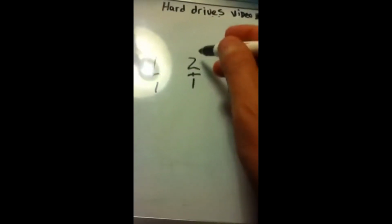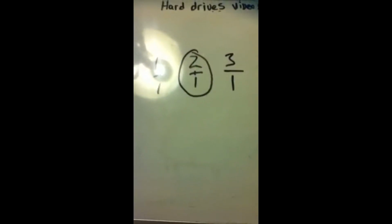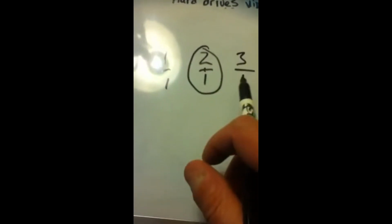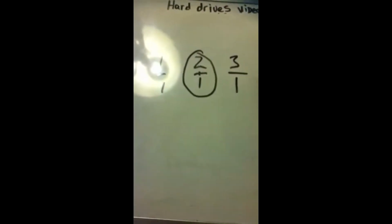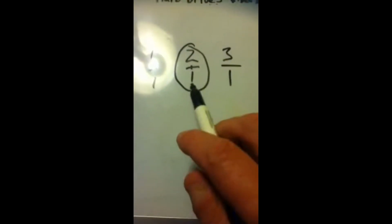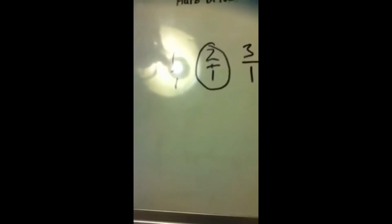Well, that's the best, right there is the best ratio to have. I wanted to make note of that. That one means it's just too shy, it skips it and has to go through another sector count before it gets to the 3rd sector. We don't want that. We want the 2-to-1. For the older hard drives, the 2-to-1 ratio is better. I had to add that.